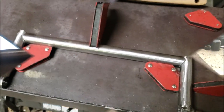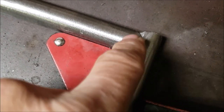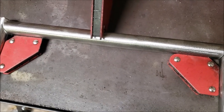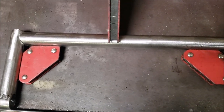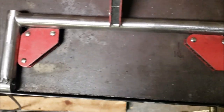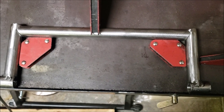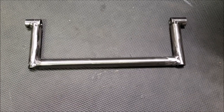I cut myself another crossbar. This time I used my tubing notcher properly and measured — the distance from the inside to the inside is 10 and seven-eighths inches, which should give me exactly what I need, maybe a 16th or 32nd more. That should be exactly where I need it. Gonna weld it up and see what happens — worst case I make an entirely new one.